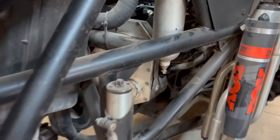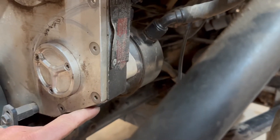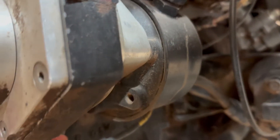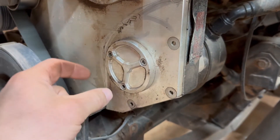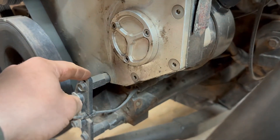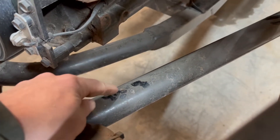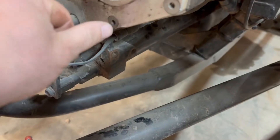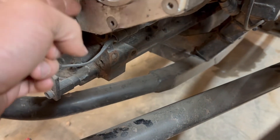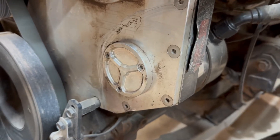I'm going to do some work on the back of my race car here. I'm actually going to cut this out — this is my power steering pump, and you can see it's got a deleted vacuum pump. Typically there would be a vacuum pump here, but I deleted that because I didn't need it and it was one more thing to go wrong. I'm not getting the performance I want out of my power steering pump, and I want to be able to lower this engine about three or four inches. You can see right here that dent is where my upper link hit — I think it was when my mount was busted off, so it doesn't usually hit. It had enough clearance, but when the mount was busted off it was low enough to hit. With this case cut out and a piece welded back in, I'll have enough clearance to drop the engine down.